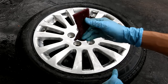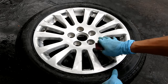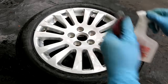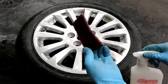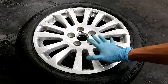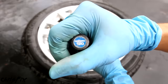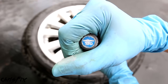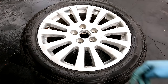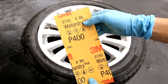After a second coat of stripper and then using the abrasive sponge again, we have removed all of the clear coat on this rim. Realize that the chemical stripper doesn't get all the clear coat off, which is why you have to go back in with either an abrasive sponge or your flap wheel to get all that clear coat removed. It's very important to get the clear coat completely removed. Now that the clear coat is off, let's move on to the sanding and polishing step. The flap disc we used is 120-grit, so we want to move up in grit from there. Because we had it on a rotary tool, it made it pretty smooth, so we can start off with 400-grit sandpaper.